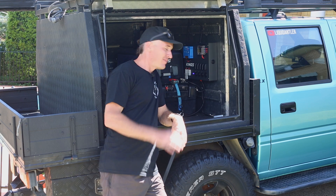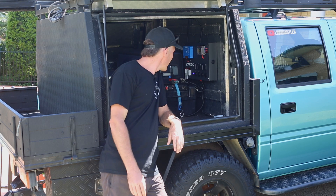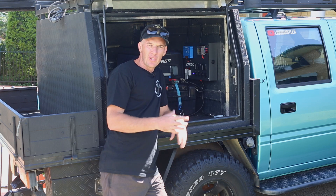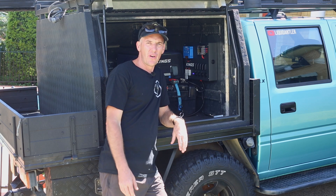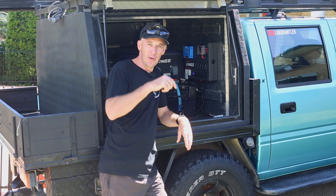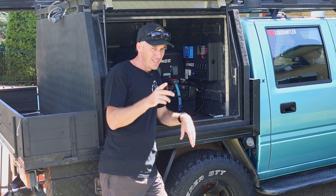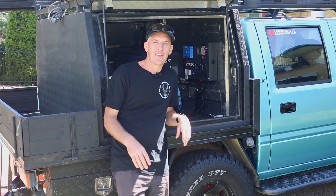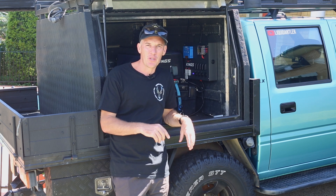There's the finished product. Super stoked — it looks clean and tidy, it's definitely smartened up the back a bit. The only thing I am a little bit concerned about is the voltmeter reading between 15 to 15.2 volts. Not sure why it's so high — if anyone knows the answer to that please feel free to drop a comment below. I thought it would be sitting at max around 14 volts. That's just running off the solar — 15.1 seems high but it seems to be running. If you do know why it's running so high, please drop that in the comments.